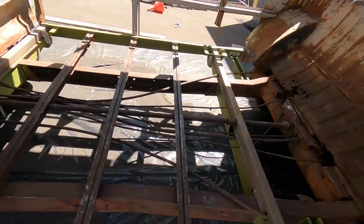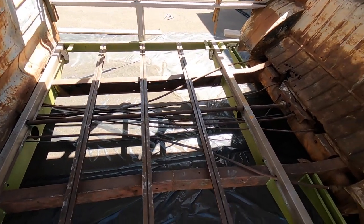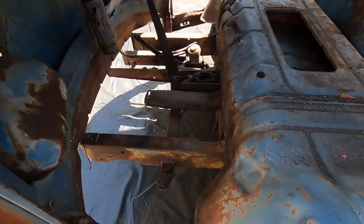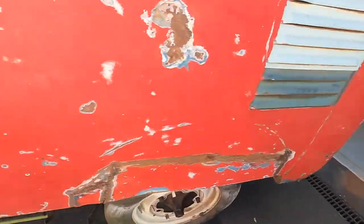I mean, it's cleaned up the metal. All I'm going to do now is get the Ferronite rust converter / primer all in one, and then hit it with the epoxy. That'll take care of that whole area there. This bit here, I've just got a little bit more to go inside there. We'll just give it another, just sweeping up all the stuff on the bottom now. We'll do it again.